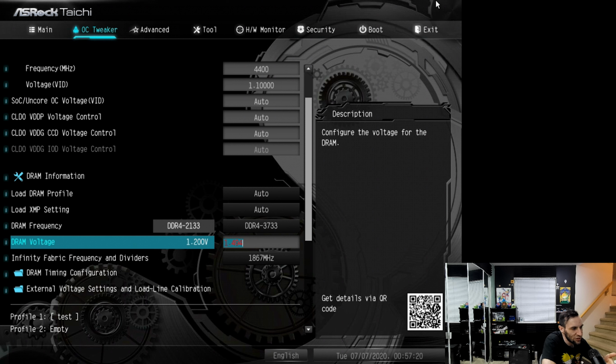And there's two ways you can test that. You can just put a fan over your RAM, and then if it runs stable all of a sudden, then you know they're heating up too much. That's pretty much the best way to do it, to see if it's heat related or voltage related, right? But I know these RAM sticks, the Viper Steel series, they got really good heat sinks on them, so I know 1.5 volts is fine on these ones.